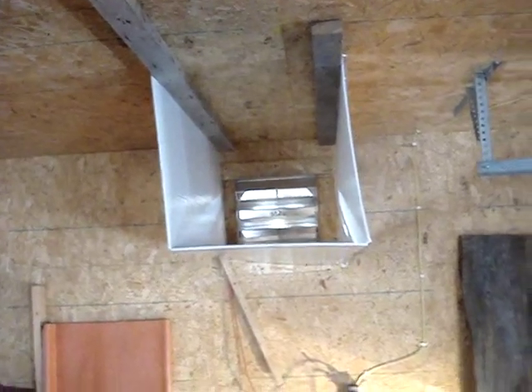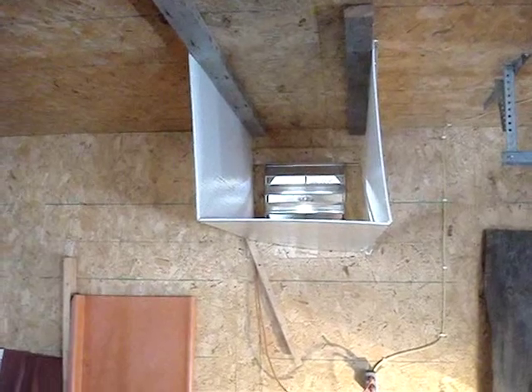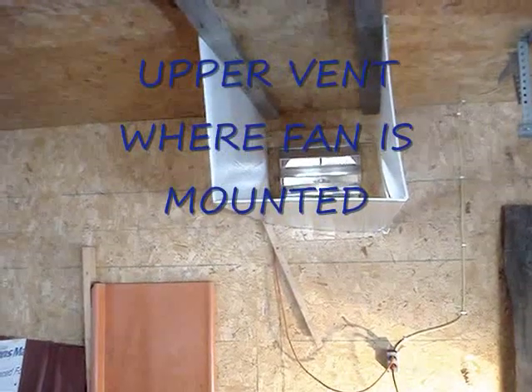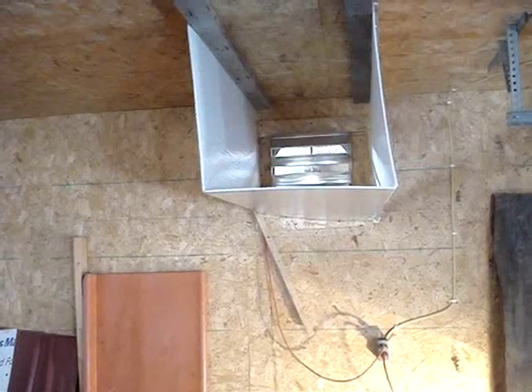We just got that little shroud on there so it doesn't blow straight down at the floor. Otherwise it would kind of circulate that air back into the intake manifold right away. That way we maintain the cooler temperature going into the intake on the bottom of the floor.